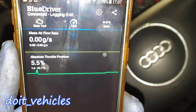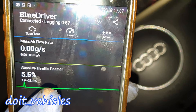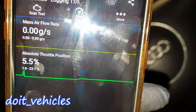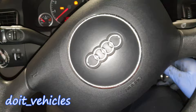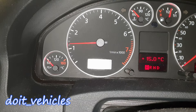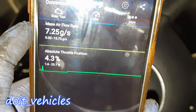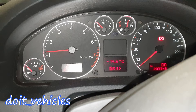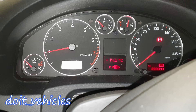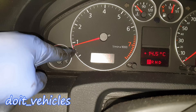I'm going to reinstall the throttle body, start the car and see how it idles. I'll also check the mass airflow rate, which can be decreased if the throttle body is dirty since it won't allow air to pass through. Wow, look at that — the engine was cold and it's not 1500 RPM anymore, it's below 1500. In my situation I think I fixed the issue. The car idles much better — before the needle was around 700 RPM, now it's where it should be, around 900 RPM and quite steady.